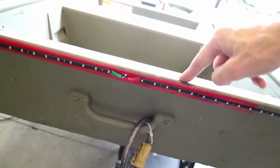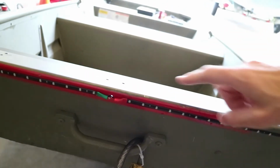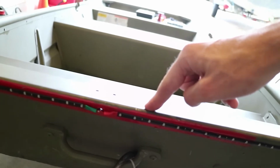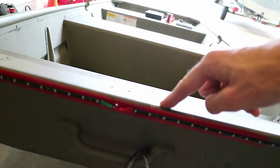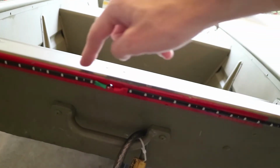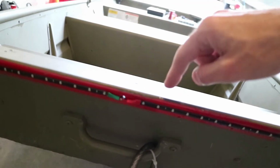I have two LED light strips I got from Amazon, and I'll link those in the description below if you want to pick those up, and they're actually really nice and they're sealed. So I took the positive from each side of the LED strips, connected it to the positive wire going to the rear of the boat, soldered it, and then heat shrinked it so it's nice and sealed and waterproof. I did the same thing on the ground. I took both of these LED strips grounds, soldered them to the wire going to the rear of the boat, and heat shrink wrapped them.